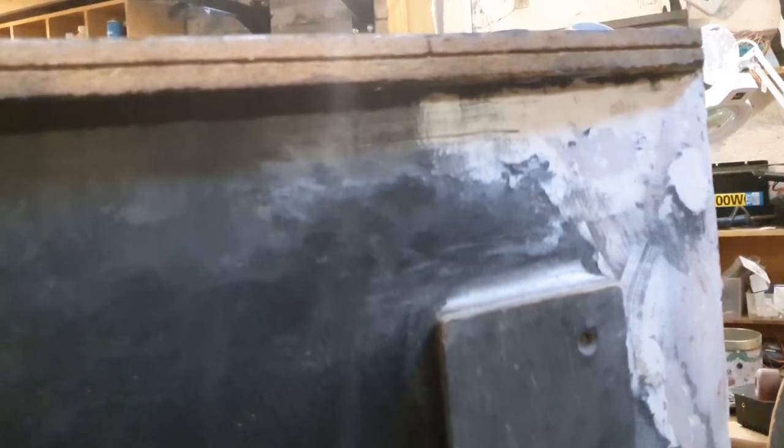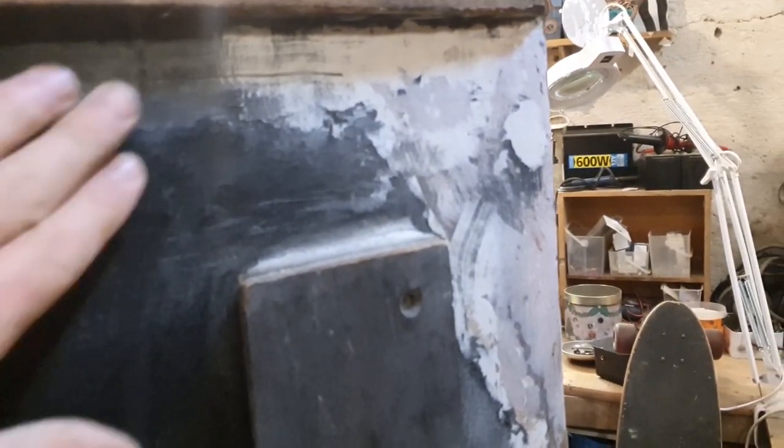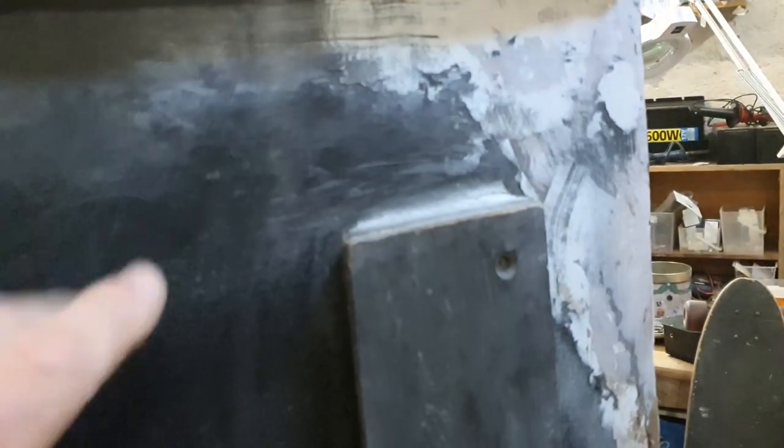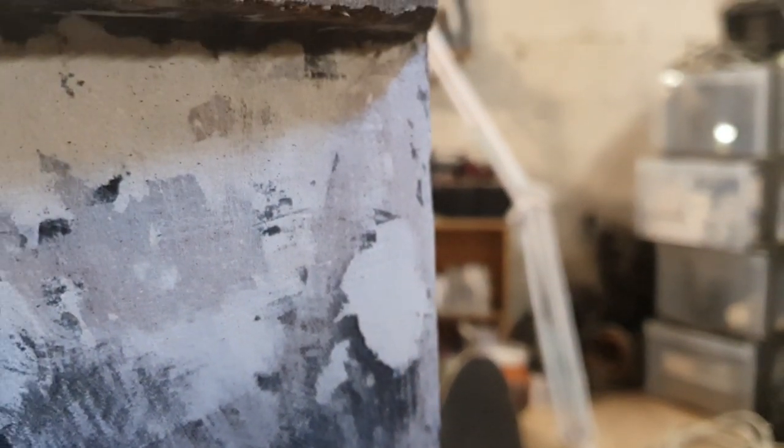So I might put just a first coat of paint. First coat of paint would actually help me see all the bumps. Once it's all uniform, one color, see where all the bumps are, sand that back, and then reapply paint or Bondo if needed, just to really smooth everything. But right now I'm not seeing too much. Yeah, you can see here it's like small gaps in the hole, so I'm just gonna apply paint, sand, and rebondo afterwards. But I'm gonna do this once the cab is up.